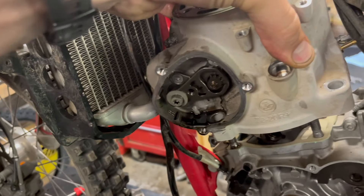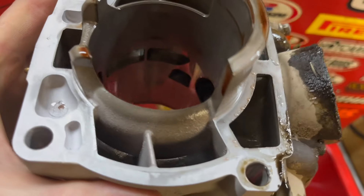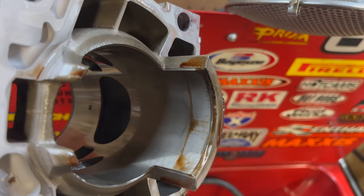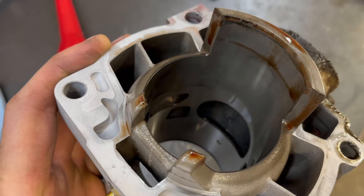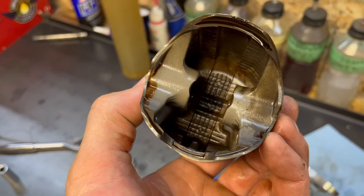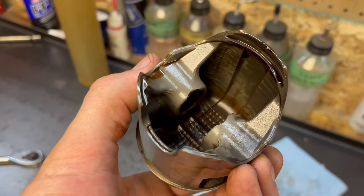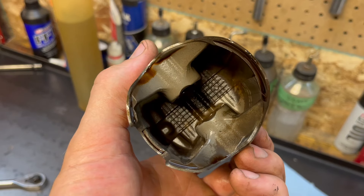Let's see what we find. Let's turn it upside down and get the coolant out. Nothing crazy looking in the cylinder — got lots of crosshatch everywhere, I see lots of pre-mix there. It's looking good. Looks like a pretty normal amount of buildup on the power valve; I'll pull that apart. Look at that piston out of there so we can have a better look at it — look at that pre-mix down there, all over the piston too. Looks super nice. I see some black in the middle there, nice brown on the bottom of the piston. So that tells me that my jetting is very, very close.